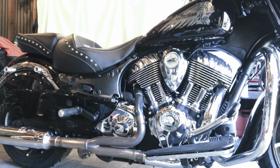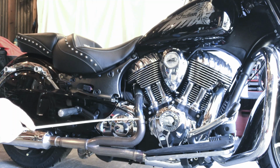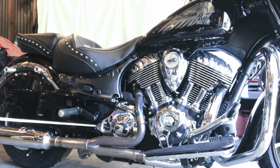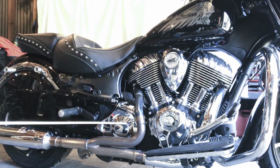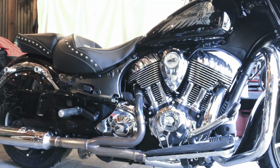You go ahead and tighten all those down, and those get tightened to 31 foot-pounds using a 15mm socket. Once those are torqued, I then move up to this clamp here that's supplied by FuelMoto for the jackpot head pipe. That goes to 10 foot-pounds using an 11mm, and then the same thing under here. This one goes to 31 foot-pounds using a 15mm, and once every single nut and bolt is tightened down, I then took the bike out for a ride.